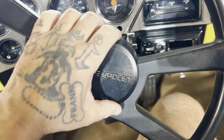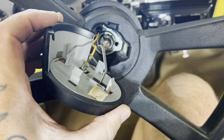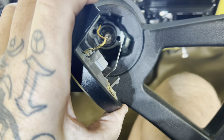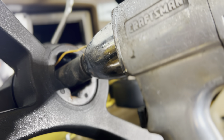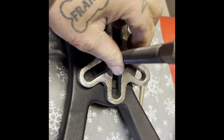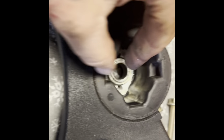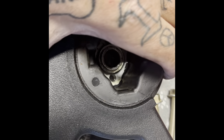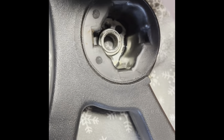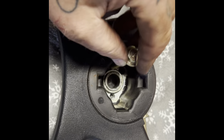I don't know if this steering wheel is actually what was supposed to come on it, but you just pull back and it pops off. It's just got that spring-loaded arm sticking up that keeps it in there. So I will detach that yellow wire, which I'm presuming is for the horn. We zipped off the steering wheel nut. Pull the steering wheel off — they have a host of different pullers that you can use. It has a blunt end. You've got the shaft running up through the center with a nut and some threads. Zip off the nut — the steering wheel is on splines, so you'll have to use some sort of puller. These come in the kit, and those screw down into the holes right there — one screws in there, the other one screws in over here.